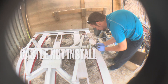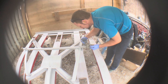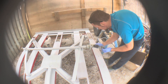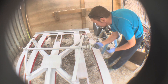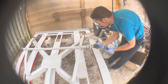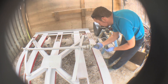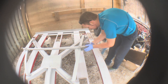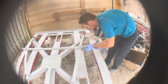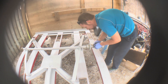Castle nut install. Make sure she is snug but not tight. Now, there is a seal on this side — you want to make sure it's good to help prevent water from getting in. This seal is fine, the other seal is fine — make sure they're present. Sometimes there will be a washer inside here; I've never known this trailer to have a washer, but I would prefer there to be one. You want this nice and snug, and then just back off a little bit — right about there.